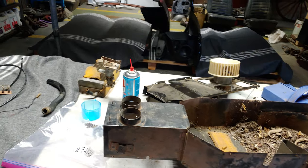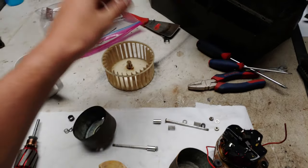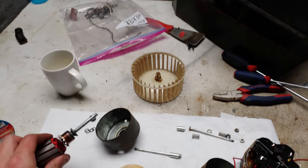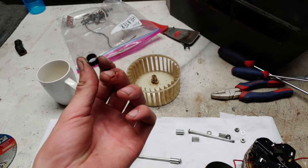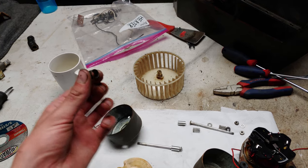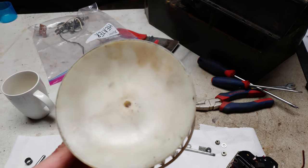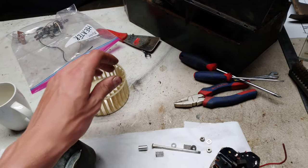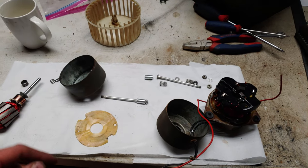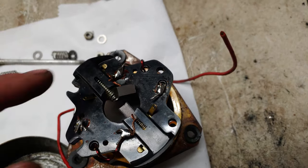So updates — my hands are absolutely busted because I tried to get this little fan off the shaft. You'd think you could just pull it off, but it has a little collar that slips over the shaft and bites into it, so you need to push it off with a screwdriver where there isn't a lot of space, then smash it out. I used the heat gun to heat it up and then smashed it out. While I was at it I figured I might as well open up the motor and clean it out and re-lubricate everything, then reassemble it.